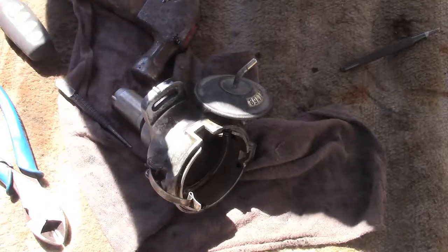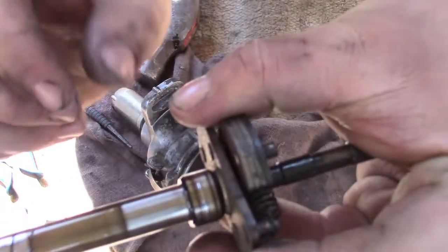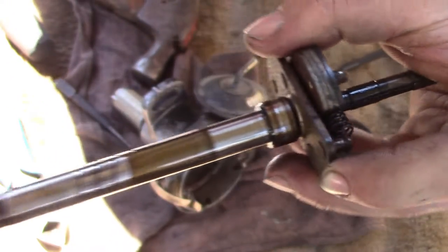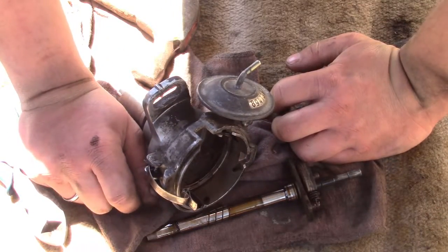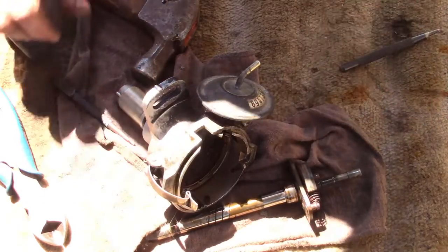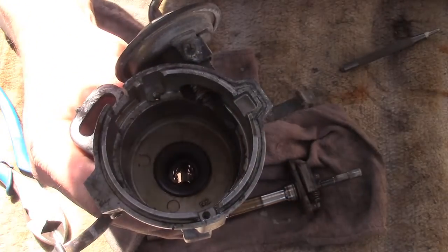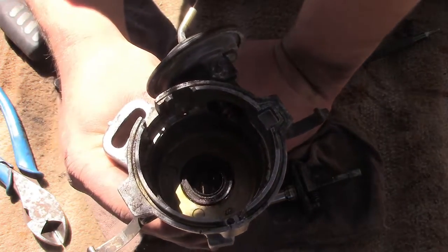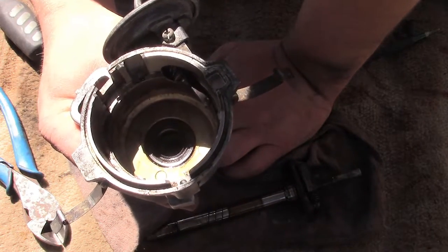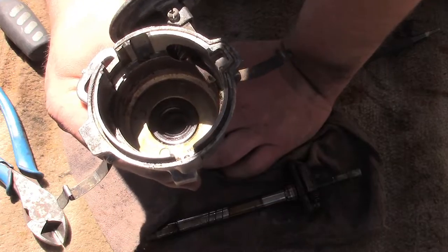Your mechanical advance weights stay on the distributor shaft. Now this is why I need a repair sleeve right here - see that little groove that the seal has worn into the shaft? I can just barely catch it with my fingernail. I don't want to be in here all that often, so I'm going to put a repair sleeve in while I have it apart. And then there is the seal that we need to do. This one is 17 inside by 30 outside. I've heard there are some that are like 15 by 22 or 17 by 22, so best thing I can say is take yours apart, measure it, put it back together, order your stuff, and then rebuild it once you have all the right parts.